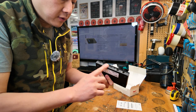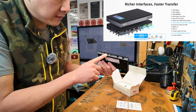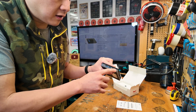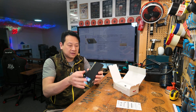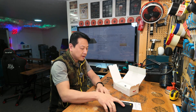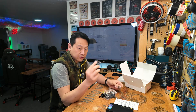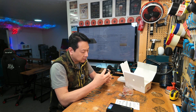There's a very rough texture on this one. On the back you've got all the ports: USB-C, headphone jack, SD card slot, HDMI, DisplayPort, two Ethernet ports, and your 12-volt input in the form of a USB-C connector. On the side there are three USB-A ports and a Kensington lock slot. This side is blank — there's no fan. The whole case is actually the heat sink, which is why they use a textured surface to increase the surface area and radiate more heat. In the second layer there's a metal bracket for mounting it behind a TV.